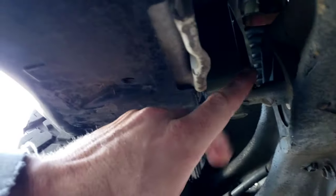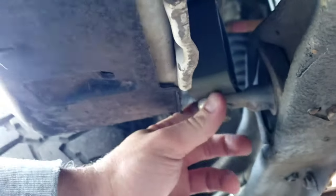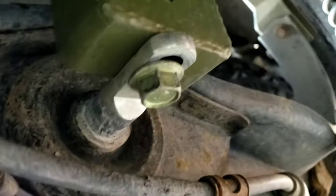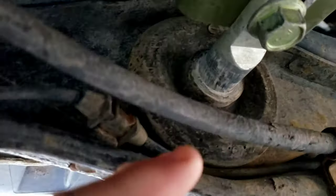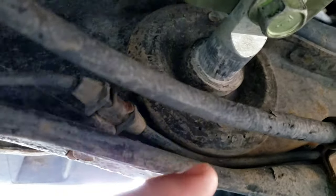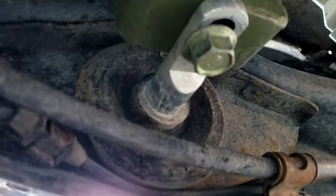All right. And you're going to have your 3-inch trailing arm spacers. These are a must with this. I actually need to loosen this one and turn it just a little, just to have it sitting correct. Highly recommend the Whiteline Performance trailing arm bushings. You push these in with some water and soap. They're so easy. They got the rod, everything. Trust me, guys, they're nice. The way they work with the lift and the pivoting and moving is just amazing.